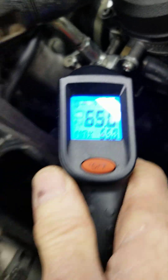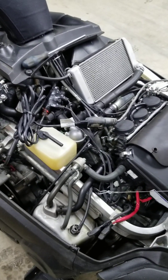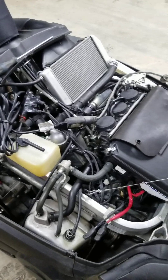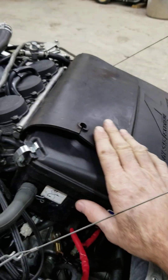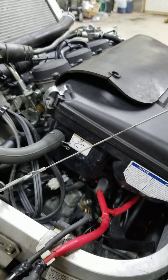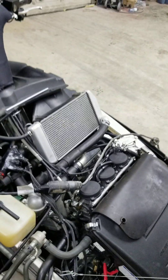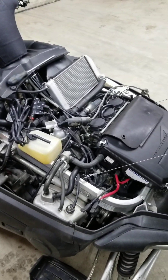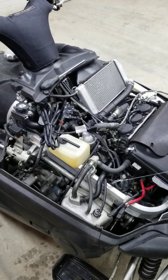In my opinion, this is an absolutely useless heating system, and it's installed exactly the way the factory says — it comes as a kit. I'm going to install a different heater and I'll do a video when I do it. These machines have what's called an oil cooler. If you have your airbox off and look behind the battery — tilt the battery out — there's a round aluminum housing bolted right into the engine with two cooling lines going into it. That housing is full of oil, and coolant passes through it to take heat out of the engine oil. I've purchased a silicone stick-on type heater to mount to that oil cooler — it's 120 watts, not huge, but enough to heat the oil in the bottom of the engine.